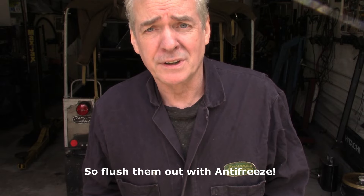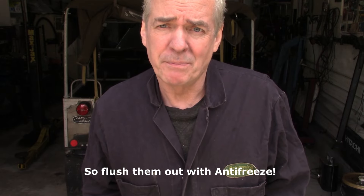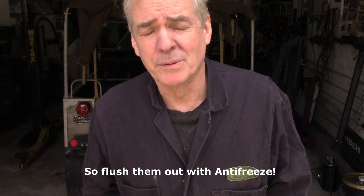Why don't they work after winter? Well, a lot of these cold power washers get put into garages and sheds over winter and there's not really much of a facility to drain out the water, therefore the pumps can crack. Now the cheaper the power washer, the cheaper the pump is going to be.